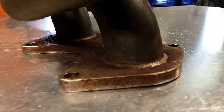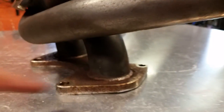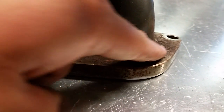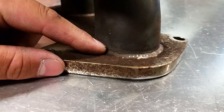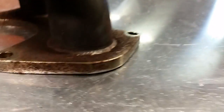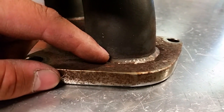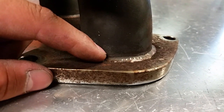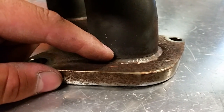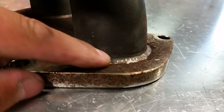So there's a lot of theory that goes behind this. It's not just about saying, hey, this is a weld-porn quality weld. The theory behind this is, when you make a pass on something, you have shielding gas. And wherever that shielding gas isn't, it'll go purple and brilliant, beautiful colors. And those are okay. But once you get this HAZ, this heat-affected zone, and it goes kind of gray, it's definitely been overheated. It wasn't sitting under shielding gas long enough. Then that's where cracks are going to develop.